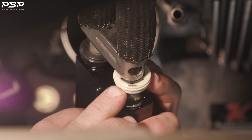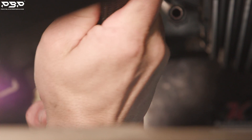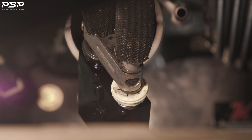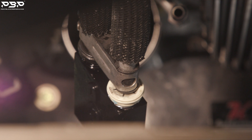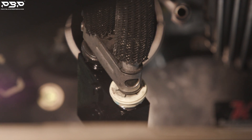Grab the C-clip and insert it into the slots. We just demonstrated that if the C-clip is not in those slots, it will come off. When properly seated you can hear it grabbing on the barb — that's what locks it on. If your transmission lines expand or vibrate, it can't come unseated. Make sure to test it and check it twice before sending it down the road.